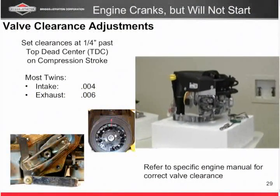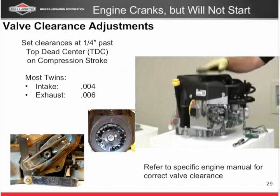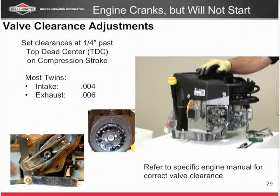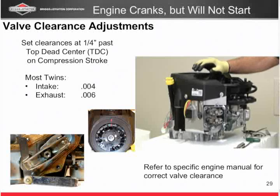What we're going to do is a valve adjustment. I've got a twin-cylinder engine here on our Model 44, so we're going to do a real quick valve adjustment on it. This may be an issue where it wasn't starting or maybe one side is dead. We checked ignition, so we're pretty much assured we have a compression issue. We did a leak-down test, and it told us number two cylinder was dead — that's where we're going to start.